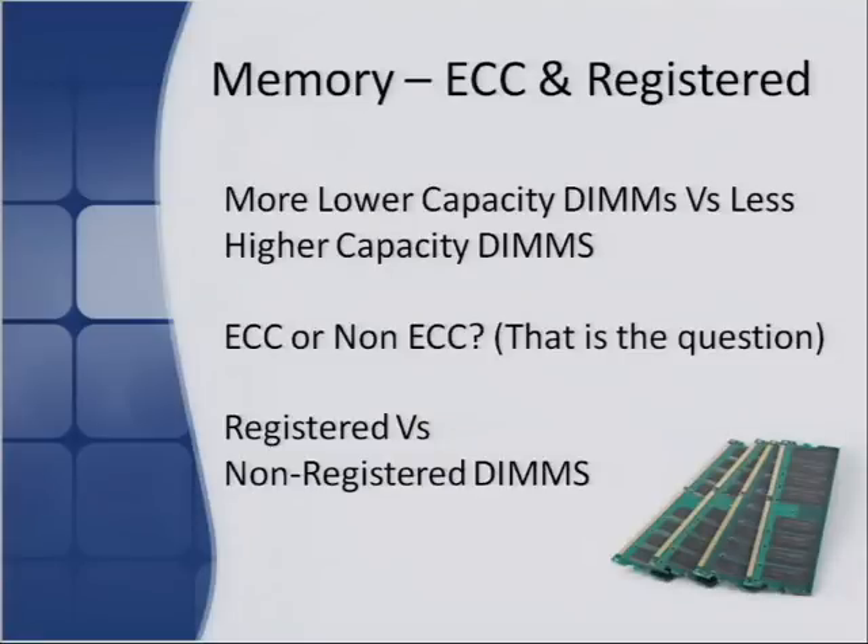Two types of memory considerations: ECC versus non-ECC — be careful with that. I see people on the blog asking, for example: 'We've just done a hardware refresh at work. I've got an HP ProLiant G5 at home, and the company refreshed to G6 or G7 servers. I've taken the memory out and want to put it in my home server, but it doesn't work.' That's more a case of registered versus non-registered memory. Be aware of particular memory types — if you're running registered memory, make sure you purchase registered memory. If you've taken memory from an enterprise-level server at work, generally it won't run in your entry-level server at home. ECC memory put into a non-ECC socket will just not use that ECC functionality.